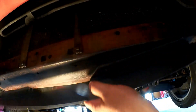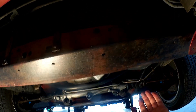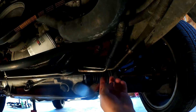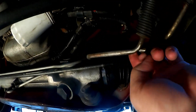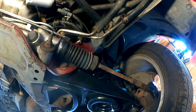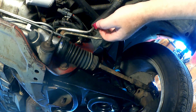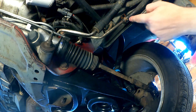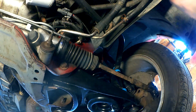This thing is just going to go up in that location. One other thing I noticed while I was down here — and one of the reasons I like working on cars myself — is that this power steering hose is leaking, and also these two power steering hoses are kind of rubbing on each other. They're able to grind each other down, and that's going to eventually wear through if I don't do anything about it. As a pretty much permanent solution, I've got this little guy here, which is made to keep spark plug wires separated, but I think it's going to work well here to keep those hoses separated. I'll have to replace these soft lines — that's okay, I wanted to flush the power steering system anyway, so this is just a reminder to get on that maintenance next.